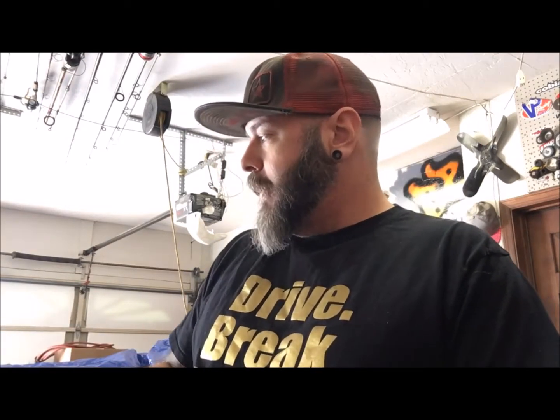So happy about that. So I'm gonna put these in, we can air the car up, move it forward some, because I've noticed when it's sitting here like this, the concrete's not level. So my frame's not sitting exactly flat. So I'm gonna move it forward, try to get it to sit down, that way when I do all the welds, it's gonna be square. So anyway, that's what I'm working on now.